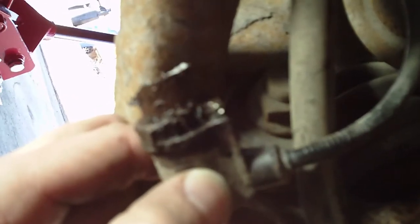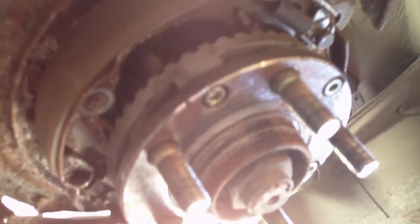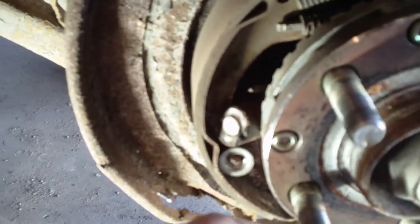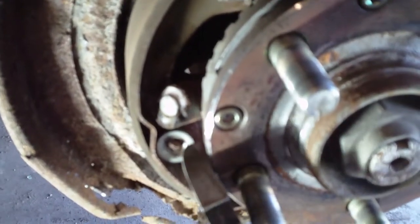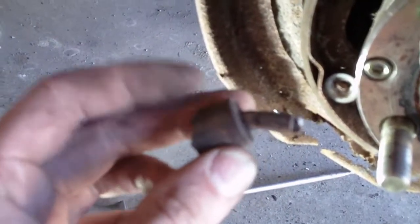I broke most of it off — I'm going to try to punch the rest through from the front. There's a little thing here I can pry off and break to give me the clearance I need. This is not ideal, but at least you're getting a walkthrough of what happens when it goes wrong. The little inside piece broke off and fell inside — not quite enough clearance to get it out. You can pry against the hub face to push the shoe out a little bit. I hammered and bent it to get a bit more clearance so it wouldn't smack against the tone ring on the back of the hub face.